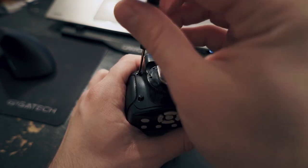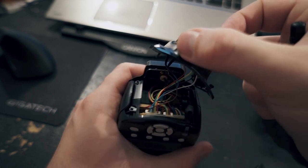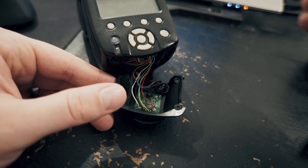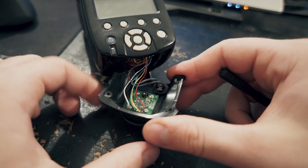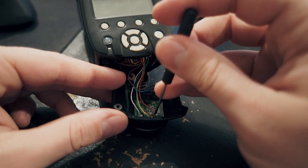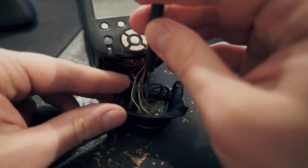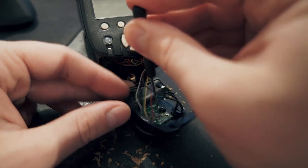Okay, so the four screws that are holding the base are off. Now if we take off this entire thing — be careful, we got cables — so gently put it down without bending any of this stuff. And now inside here, we got these four little screws which are holding this little green plate down to the base. As you can see, that's the part that's wobbling. Essentially all we have to do is tighten these four screws down into the base, which are all loose after many months, probably years of usage.